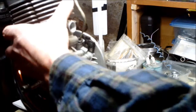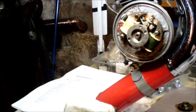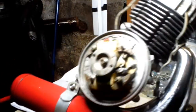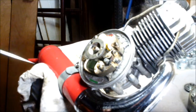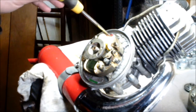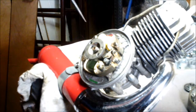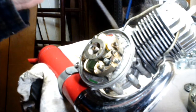Just take this engine off the jig here. Let me flip her around so you can see. There we go. We've got just the 2 coils here — no third coil. You can also see that the offending condenser is being removed from this bugger already. So now, on the inside of the generator, this is the 2 coil. This top one here — yellow coil — that's for ignition and also the 6 volt accessory port. One end of the wire goes to the points, and then the points feed up to the gray wire. The other end of the coil comes out here. Without that end grounded to anything, this will not make any electricity at all.